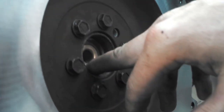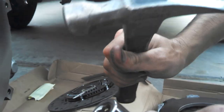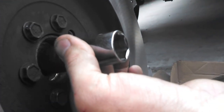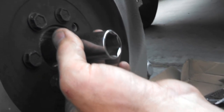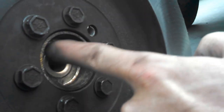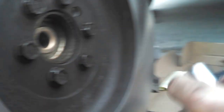I also went ahead and installed the pilot bushing. I did that by using a thirteen-sixteenths socket and a trusty little hammer. You don't want to sledgehammer these, but you do want to tap them in a little bit at a time. Get it on the outside there, little taps, go all around, and try not to go in at an angle. Keep it straight and just go around until it's flush and level with the inside of the crankshaft.